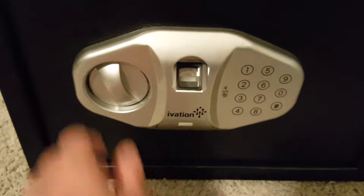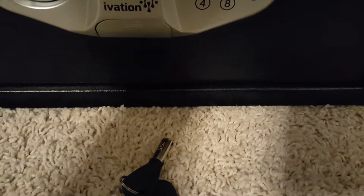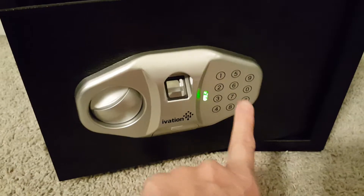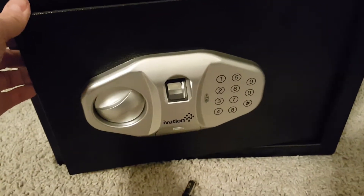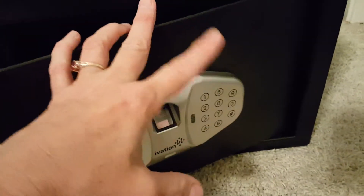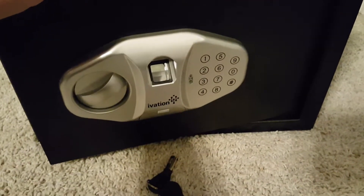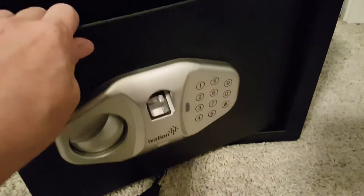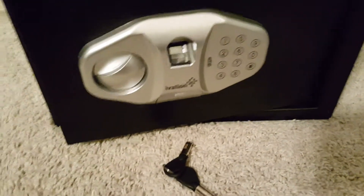I'll move this up here while I get in with my pin code. You put it in and hit the pound key, then open it. So to set the pin: open the door any way — with the manual key or your fingerprint — then punch in the code you want to use, between four and eight numbers. Press the reset button, push the code again, then press the reset button again, and that sets the code. It's pretty simple.